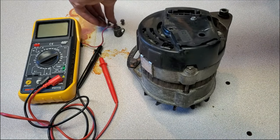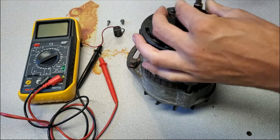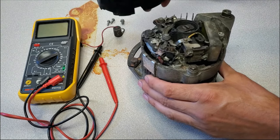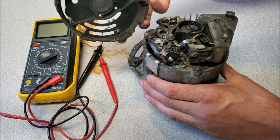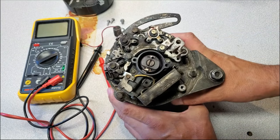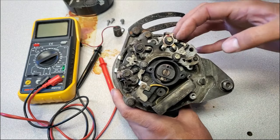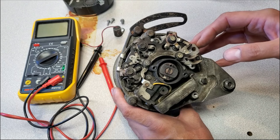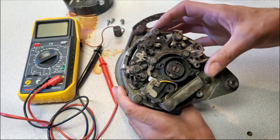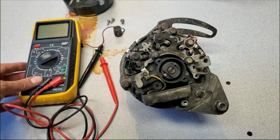Let's get the back off first. I don't know exactly what's wrong with this alternator — I got it in a pile of parts rather than testing it and figured I'd just start by taking it completely apart. There's a nice layer of grunge in there but so far I don't see anything that's burned. There's just some compound on these contacts here, which is at least encouraging. The windings appear solidly connected, so I'll get the multimeter out.